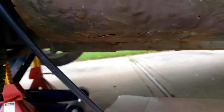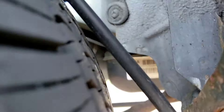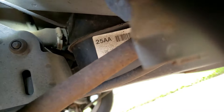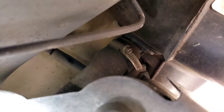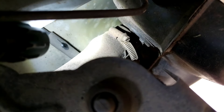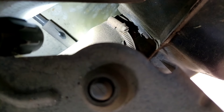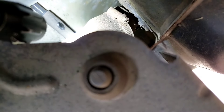Trying to find a better way for you guys to see it — it's hard. You know what, let's take this smoke machine down and shut it off. Since this oil should have a little stain there somewhere, that's gonna show something. Oh, I see it — right there. See it? You can see the oil stain there. It's that long hose right there — see it? There's the cracked hose. There's the leak. That's the bad boy. That's your EVAP leak.